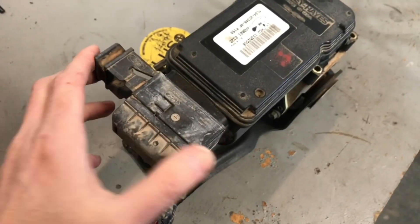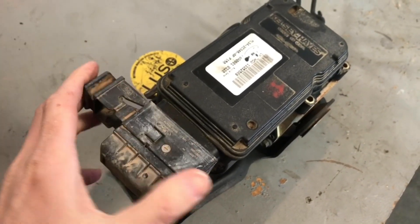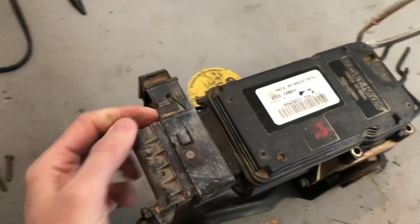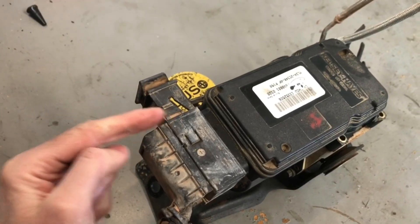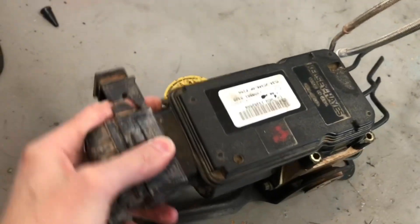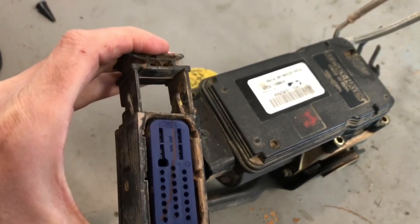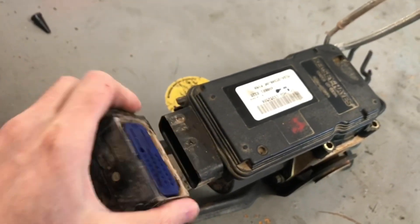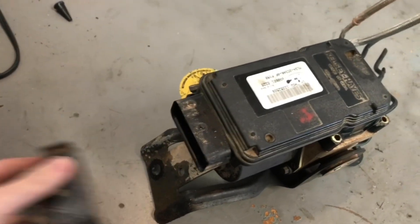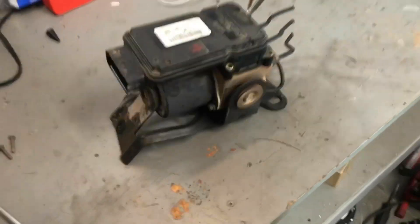This giant harness here — this piece pushes in and locks the wiring harness to the module. First thing you're going to need to do is pop it. It'll be flush all the way up against here. You'll grab this and pull it out. And then once you get it out like this, then this plug will come out. It's basically like a giant lock. So you have to pull this out before you can pull the entire harness away, and then you'll be able to go pay for the assembly and bring it home.